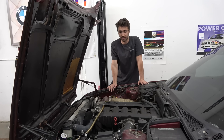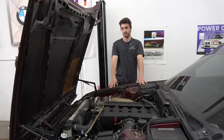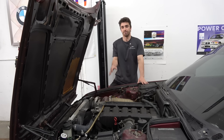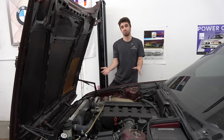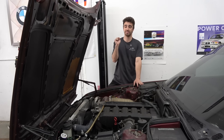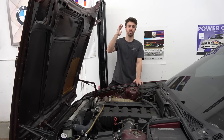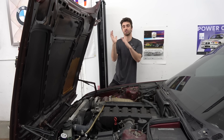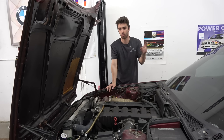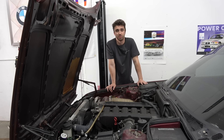A lot of people are curious about the reliability and the update on how this car has been. Let me preface this before we get into it: a lot of the reliability comes from how well the car was built and how well it's tuned. A lot of this is in the tune. I'm at 586 wheel torque — that is basically pushing these rods to their limit. You've got to be kind of cautious of that. You can't be in fourth gear and dump the gas pedal and lug the engine because you will bend the rod. So you've got to drive it appropriately, maintain it appropriately. You've got to have a good tune — you don't want to cheap out on your tuner or your fueling.